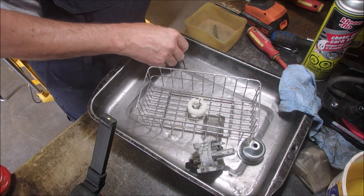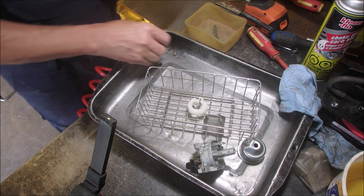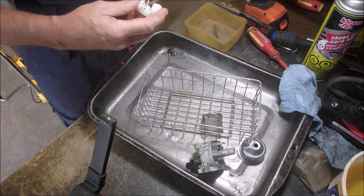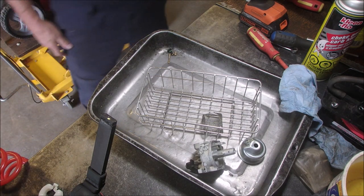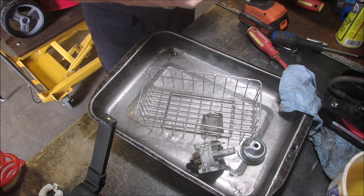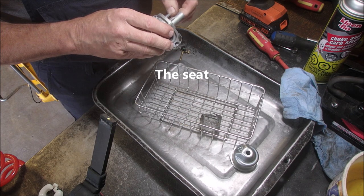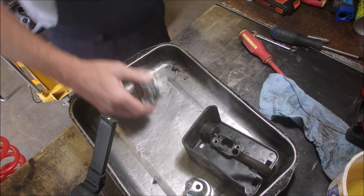I'm going to reassemble this now. I'm not touching the emulsion tube, just going to blow the water out of it. Same with the idler hole. Something I wanted to do — I'm just going to find one of these Q-tips and stick a little bit of carb cleaner on one of these guys. I'm going to go into the carburetor and clean this out just to see. We can test it.